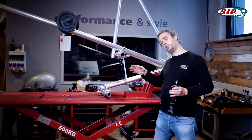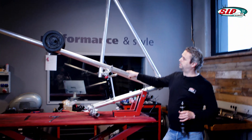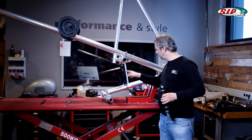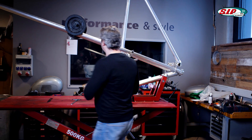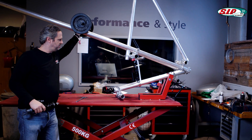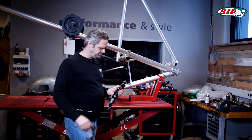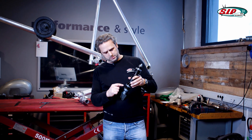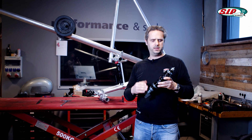Back to the scooter. I've quickly exchanged the setup for a tubular construction with a shock absorber or strut hanging onto it. If I pull on it, everything moves a little and I can measure how far. I've explained that you can use this union nut to adjust the height of the chassis, or adjust the negative spring deflection.